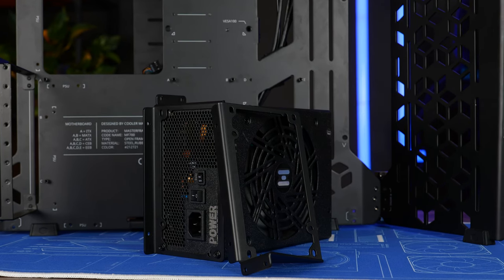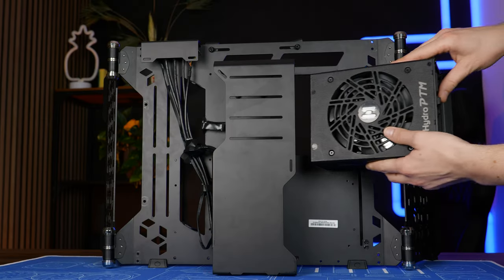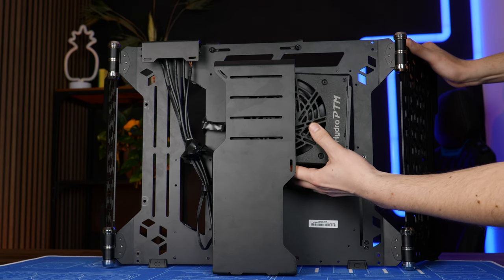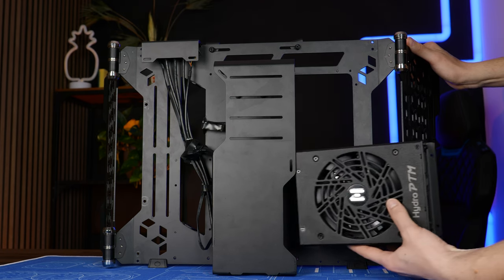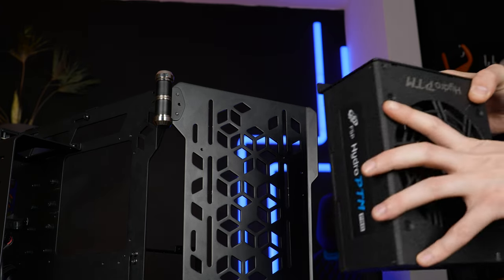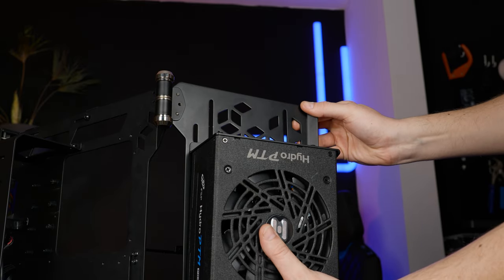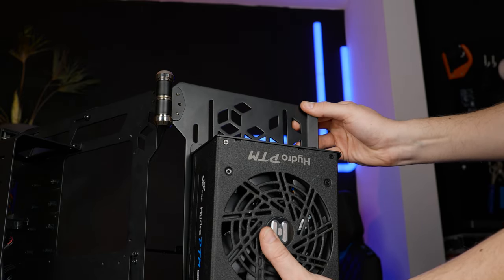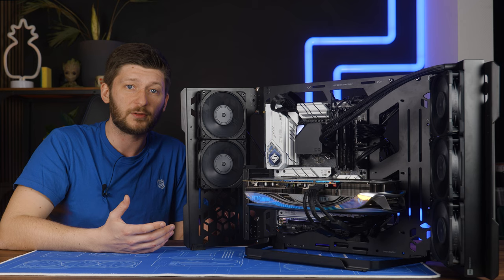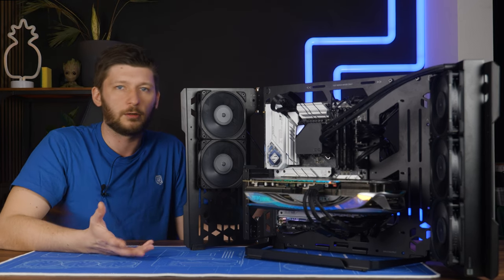For the PSU, there are three different positions. After installing the bracket onto a regular ATX PSU, you can slide it in between the main plate and the hard drive bracket and screw it onto the main plate, or do the exact same thing right below it. For the third position, mount it straight onto the backside of one of the wings. As for length, given how the PSUs are located, the sky is really the limit. Nobody is forcing you to use just one — you have two brackets, so dual PSU systems are possible without any trouble, though that doesn't make much sense nowadays.